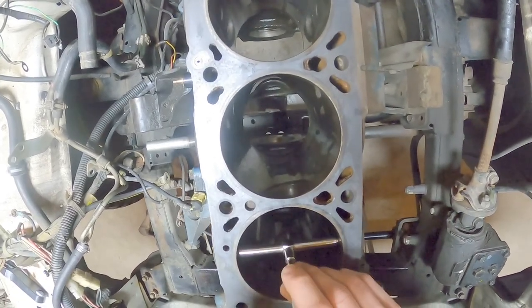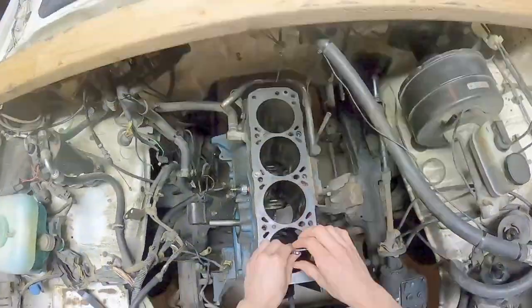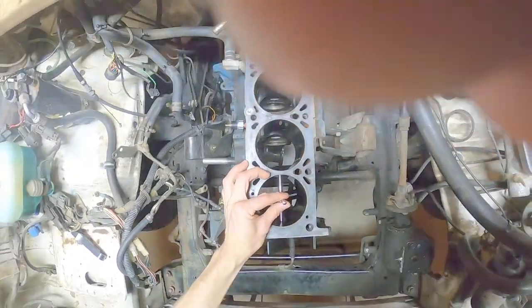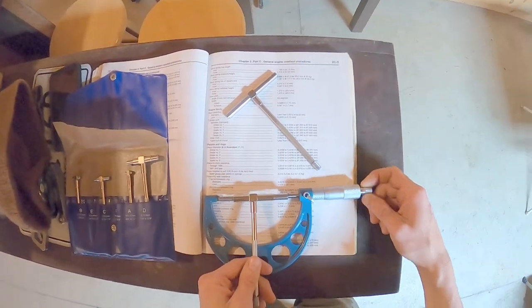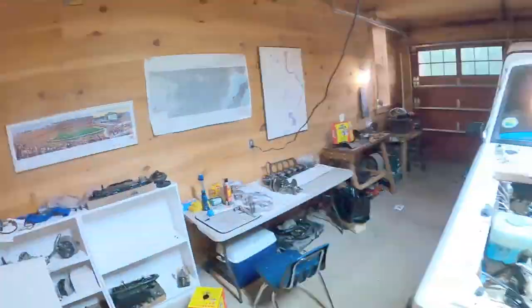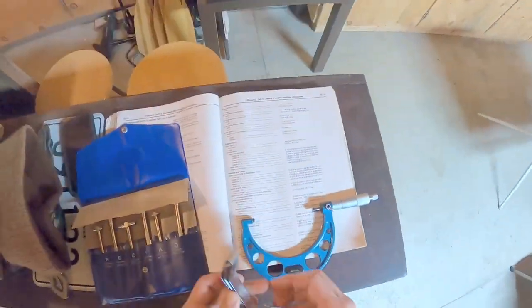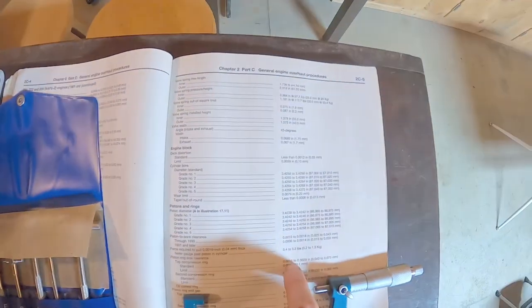It's Logan from the future here to tell you that the main reason I was having trouble with this and frustration and took so long and kind of have unusable footage is because I was looking at the wrong specs. I was looking at the specs for a different engine, an engine that's in a later model Nissan truck, and so the measurements I was looking at were different. I eventually figured that out, but using this ring method and checking the ring gap, I felt sufficient with everything. So that's your lesson. Double check that you're looking at the right specs, folks. I'll do that in the future.